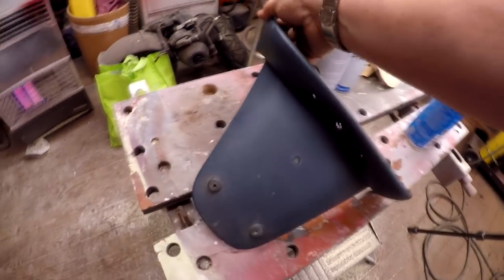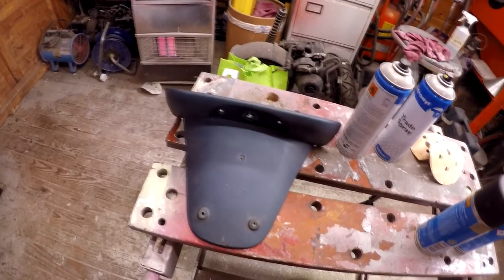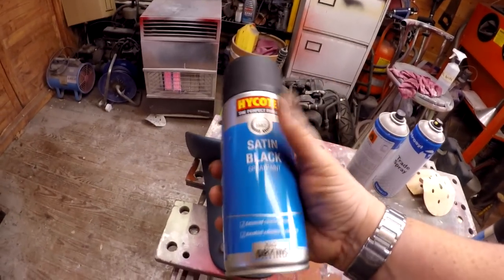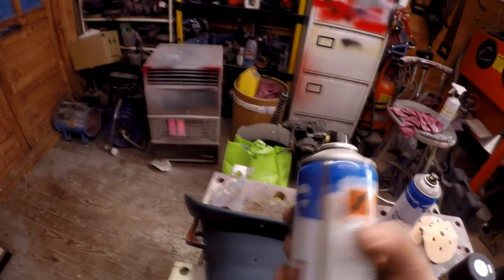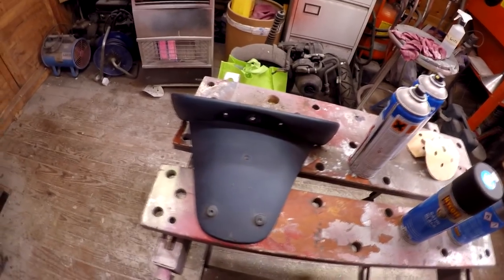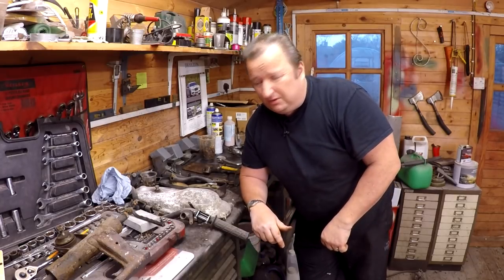We've also got the other plastics on the bike, which at the moment are blue in colour. I've given this a wipe down with a wax and grease remover and gone over it with a Scotch-Brite pad, and that's ready to take the new surface. Now I can use this paint — it's only cheap satin black paint, for plastics and metal — but just as a safeguard I've got this plastic primer. It comes out clear and puts a coat on so we can actually bond our satin black to it. So I'm going to do that with all the plastics on the bike. I think it's time to do a little bit of sandblasting now.